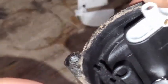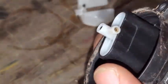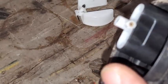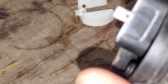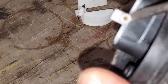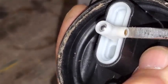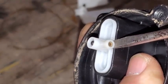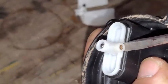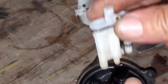Now to take this out — this is where the main jet of the carburetor is located, inside of this thing. To take this white plastic piece off, as you can see, there's a little bit of a gap right underneath here. What I do is stick that screwdriver and wedge it in there, back and forth with a twisting motion until it starts popping up. There we go — and it'll just come right out, just like that.